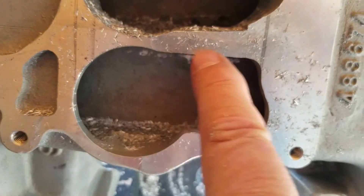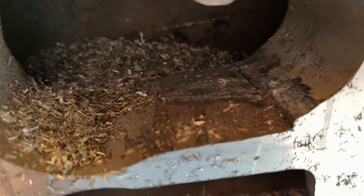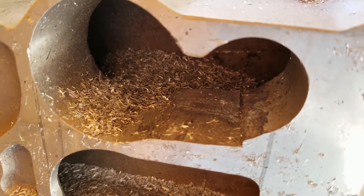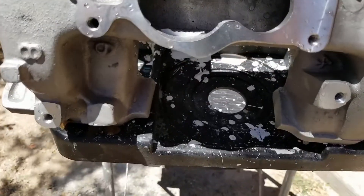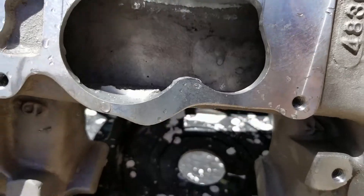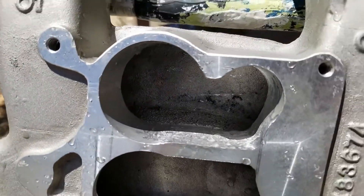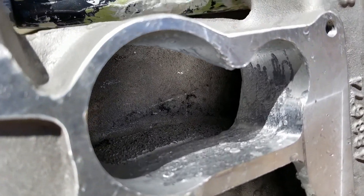The shallow side of the plenum is now ready for sandpaper rolls, and I may true it up a little more once I get the other side done. You can see there's just a ton of material in here I've got to get out, so I just have to be patient, keep my cutter lubed up, and take my time. After rinsing, I think I've got it roughed in — you can see the pencil line where the Holley gasket is, and there was just a whole bunch of material in there that had to be cut out.